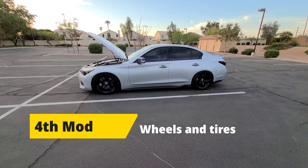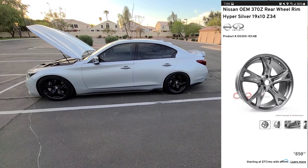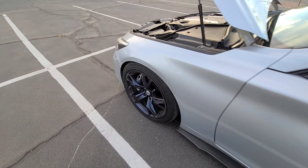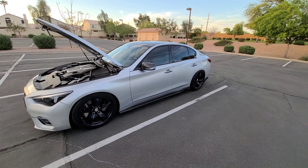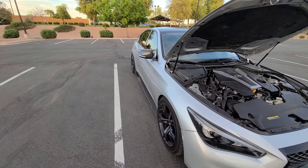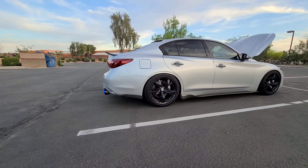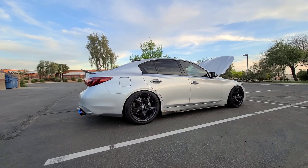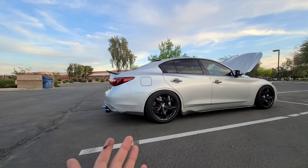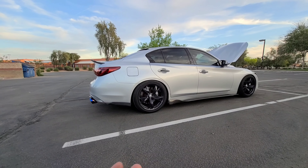The next mod is wheels and tires. To put power to the ground you need wider tires and wheels to support it. I have Sport Rays from a 370Z — 19x10 all around — with a 285/35 in the rear and 275/35 in the front. You have to be really careful picking wheels for this car. You usually need a high offset to make them fit; the Sport Rays are a 35 offset. If you want to run an 11-inch wide wheel you'd need around a 50 offset.